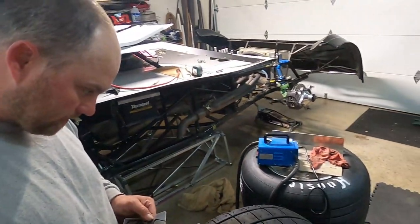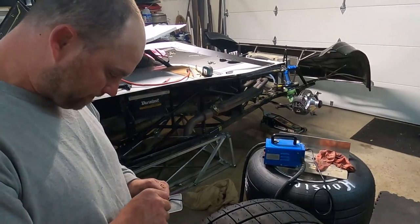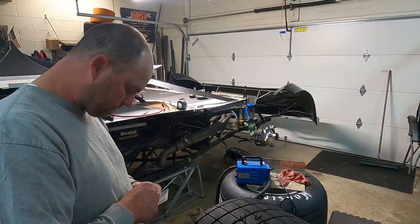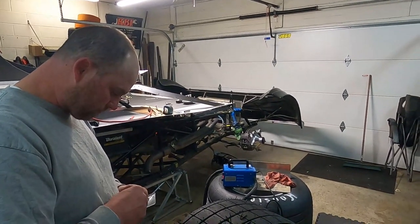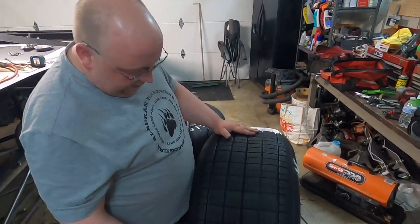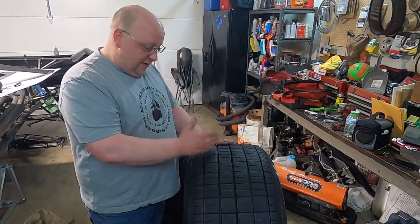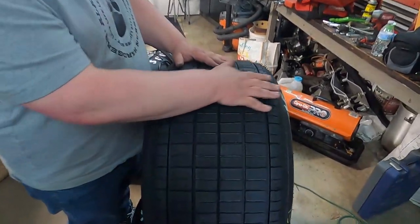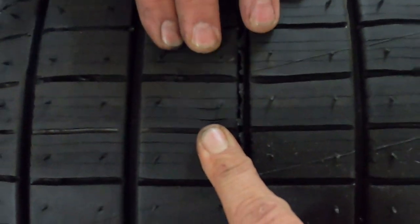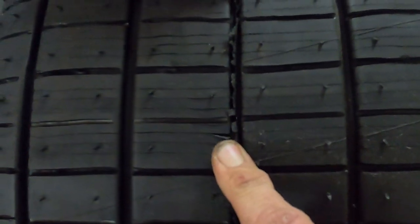All right, we're gonna make a big decision here, swap out the Van Cheapstine and keep a couple more grooves, and I think this is gonna be our last tire. We're gonna call it quits here, getting tired, getting late. So we still got the 92 right rear. We decided to take the big blocks down half this way, and then we put some sipes in there to get an idea of what we want it to look like at the end. I don't know if you guys can see the sipes in there very well. We did them cold with just the razor blades. We'll heat them up and get the rest of it done.